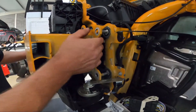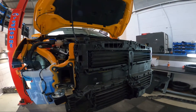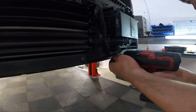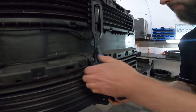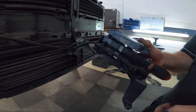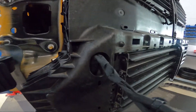Make sure to manoeuvre past the horn bracket like so. Next, we will be working on removing and stripping the front crash panel. This panel will be the panel that we modify to allow the intercooler to fit in this gap here. The first step is to remove the crash radar using two T30s. This will then lift up from the bottom and then unclip — slide it up like so. Follow the wiring, two clips and remove from the panel. Once the radar has been removed, disconnect through its connection and use a trim removal tool to remove wiring clips all the way around along the panel until all the wiring is loose and able to pass through that hole once we remove this panel.